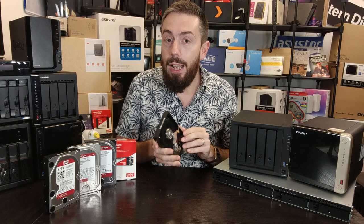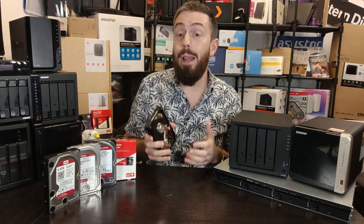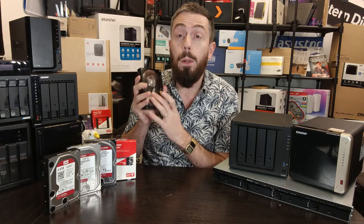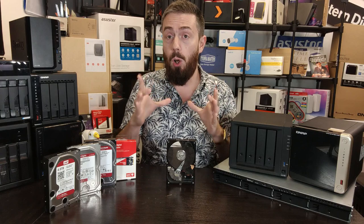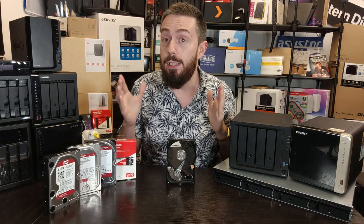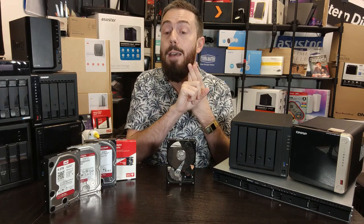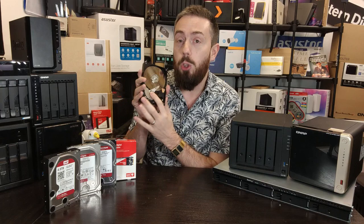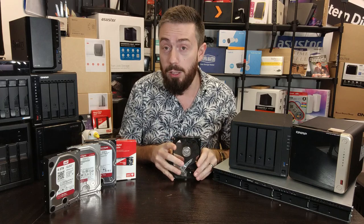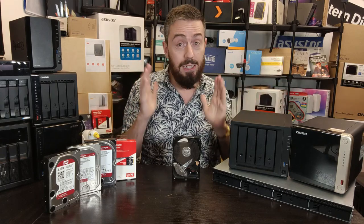The other big innovation during that time was EPMR — Energy Assisted Perpendicular Magnetic Recording — the process of applying electric current to the main write head during write operations. The result was an increased bit-per-inch on the platters, allowing data bits to be closer together and therefore increasing the areal density of the discs. Combined with OptiNAND and EPMR, the Triple Stage Actuator — working more like the joints of an arm to allow greater flowing movement of the read head — allowed individual platters to reach 2.2 terabytes at time of recording, and that's only going to get better.